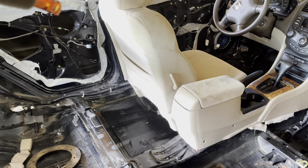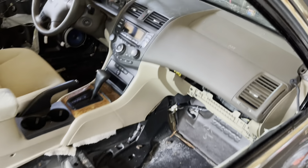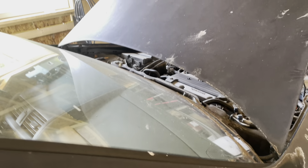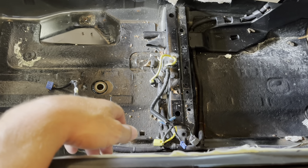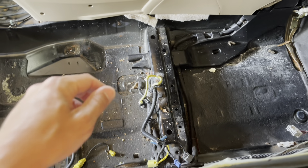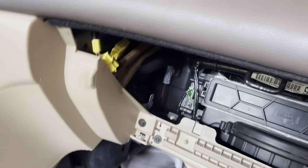For anyone new to derbying, whenever you're unplugging things, don't ever cut — just unplug. Kill power to the battery, take the terminals off. The yellow connectors are your sensors and in particular your airbags — from the seats to the doors to the roof, they're all yellow.